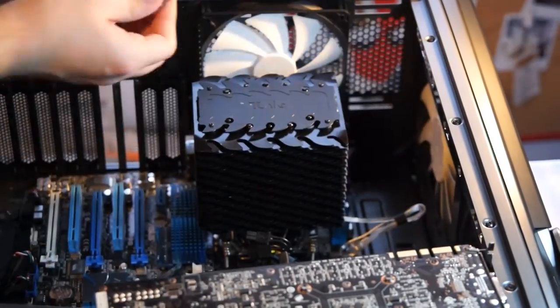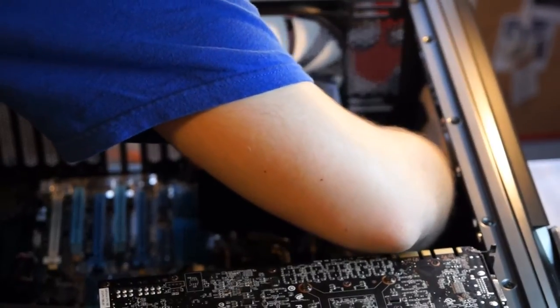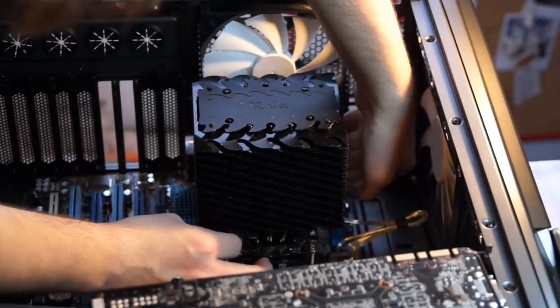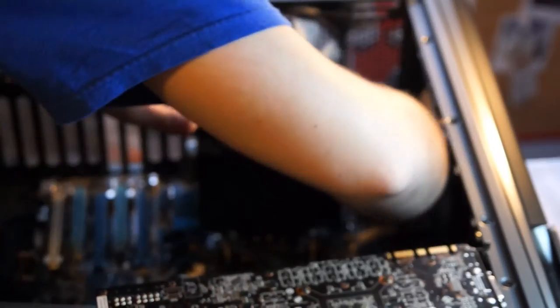Installation is pretty easy. If you're using an LGA 1155 or other recent socket type, you'll need a separate mounting kit for the cooler to fit your socket. The back plate uses rubberized washers to help hold the plate in place while you screw it into the top side, which makes it painless to install in general.